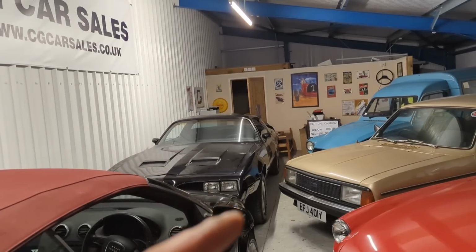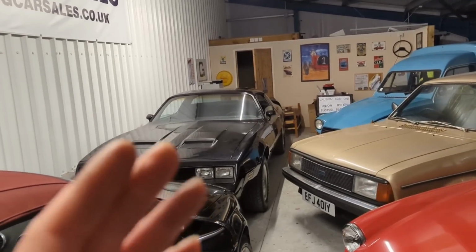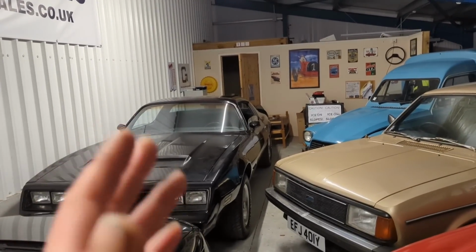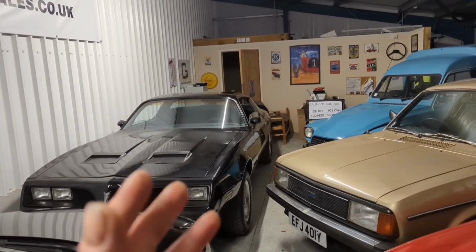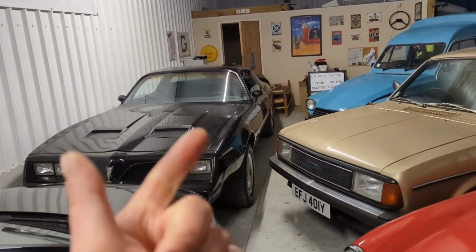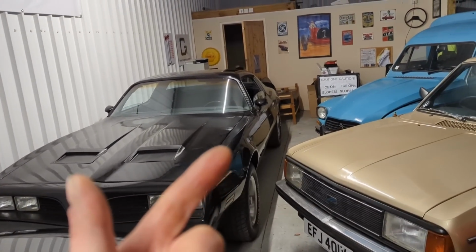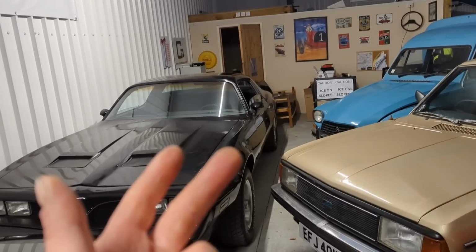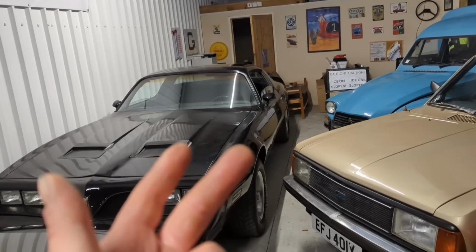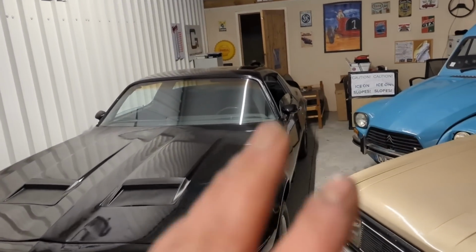If you know Joe over at Shifting Metal, he tends to work on about 5 grand on this Land Rover stuff. So that's not unusual. And they said, could you guarantee an underwrite at that kind of price point? So I said, well, if it has a full service history, if you start it up and there's no timing chain rattle, and I was also advised by one of my mates to check that the balance shafts aren't making a noise, a bit like a drive shaft noise as you pull away. So I said, if you can check those things off for me, they're all good.